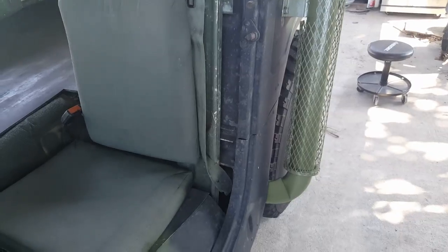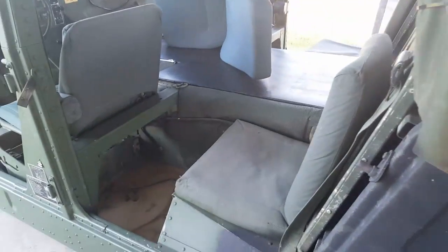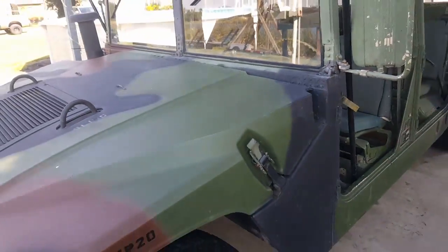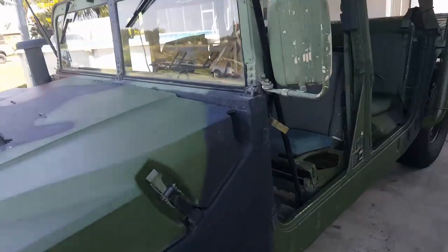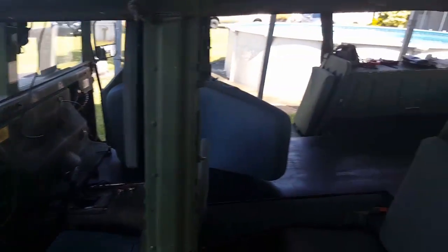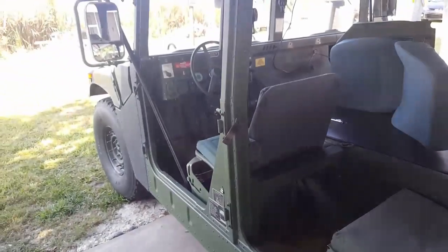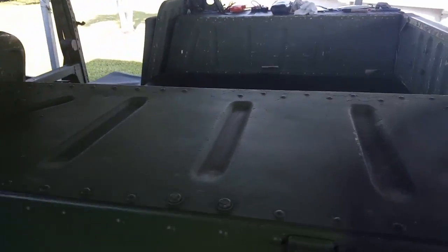It was really tight putting it on, not much clearance, but it's on and it looks good. The reason I did that — I've had my Jeep gas engines always under water. You can get them hydro-locked, pull a spark plug and spit the water out, no problem. But these diesels, I don't really know how to get the water out. My best theory was to put this pipe on so that if it shuts off while I'm underwater, it kind of saves me from getting water back in the engine if the exhaust valve happened to stay open when it shut down.